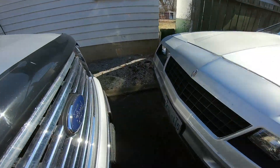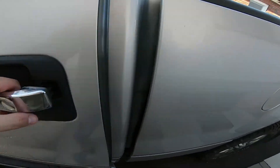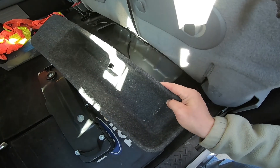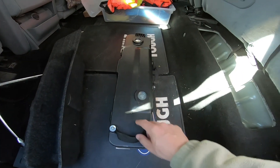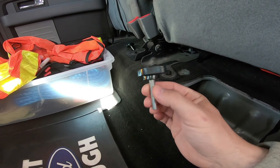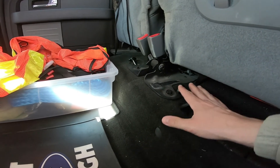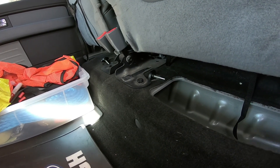Let's walk around the truck. On a super crew cab, you go to the back here and you have to lift up your seat. There's a compartment down in here — you've got to pull out the boot. Here's your jack; all your jack stuff will be inside this, tucked up in here. You've got to loosen off these wing nuts — there's one up here and another one closer to the passenger side. Lift up the seat, unscrew both of those, and you can slide it out.